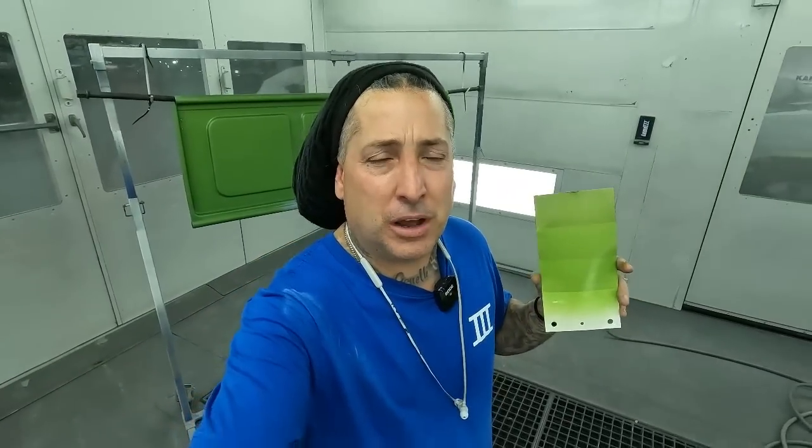And that's because what happens a lot of times when guys are doing them custom jobs like that is they'll seal that truck or whatever car they're doing with like a medium gray, and then once that color looks covered, they'll just do one drop coat and they'll clear the job, because they're not matching anything. They're not really going after a color match on a vehicle, being that they're doing the whole truck or the whole car.